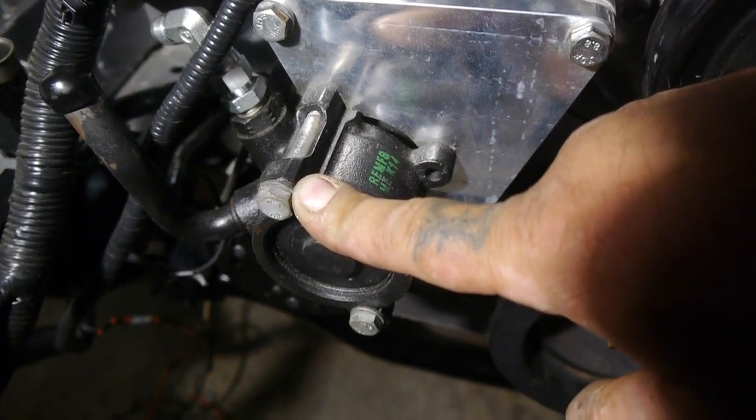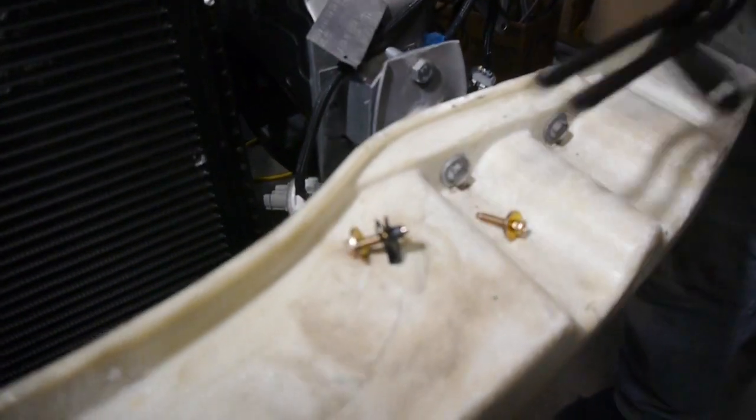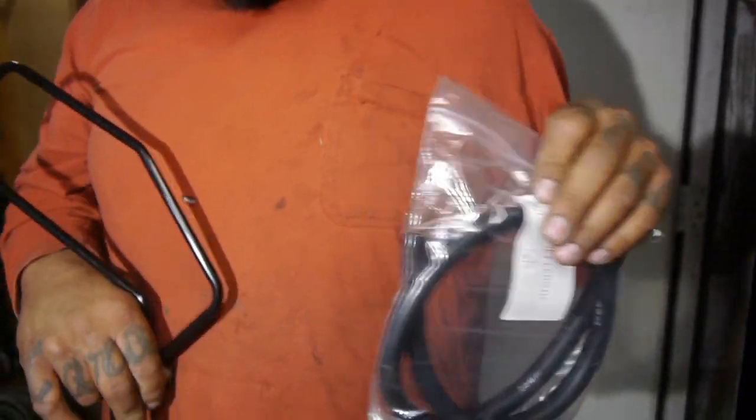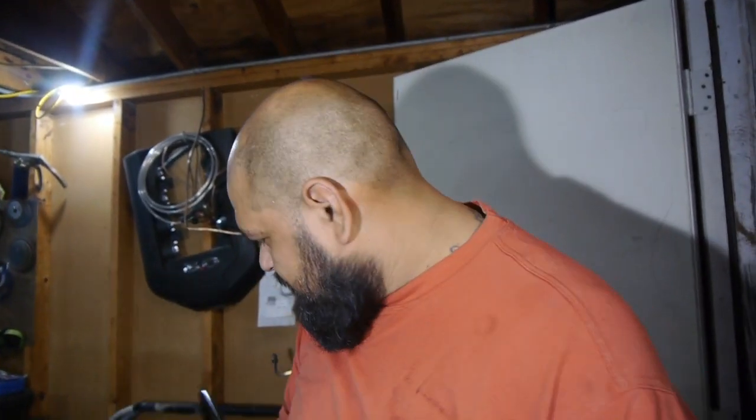The second opening from the power steering reservoir will be going to our power steering pump. We went ahead and got this cooler line to make it look a little neater - I like the contrast and the heaviness of the metal. I had a really cool aluminum line I thought I was gonna make, but too much work, not enough days. We got this from LMR, it was a kit at $40.99 - it comes with bolts, screws, the speed nut, and an extra rubber return line.